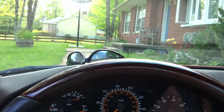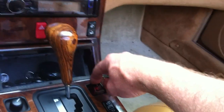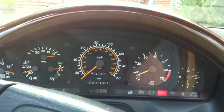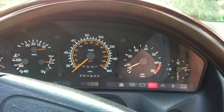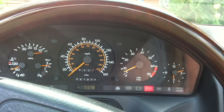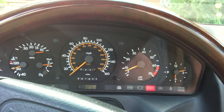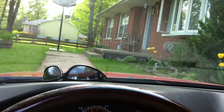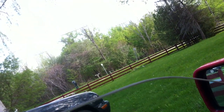If while you're doing this your soft top button starts flashing and doing wonky things, that means it doesn't know what you're doing — it thinks somebody's monkeying around with it, which oddly enough they are. If that does happen, all you have to do is turn the car off, take the key out, turn the car back on again, and everything should be hunky-dory. It will reset itself and go through the process all over again. And that is about it — thanks for watching.